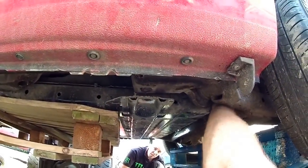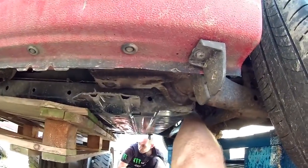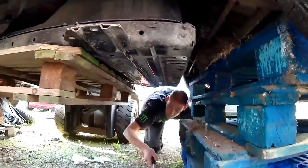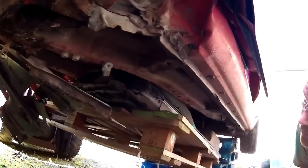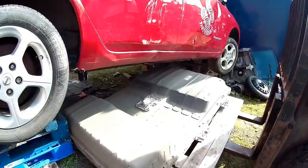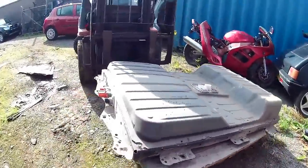It was relatively easy to drop the pack, to be honest. There's a massive fuse in the top of the rear battery tray, which is underneath an inspection cover in between the rear seats and the rear footwells - a huge fat fuse that we're taking out. The auxiliary battery was obviously disconnected, and we disconnected the orange cables from the front of the pack. It then drops down - you can see at the front of the battery there were three large connectors going into the front of the pack. It's a considerable weight - a 24 kilowatt hour pack - and you can see in the middle of the pack was the connector with the fuse taken out.